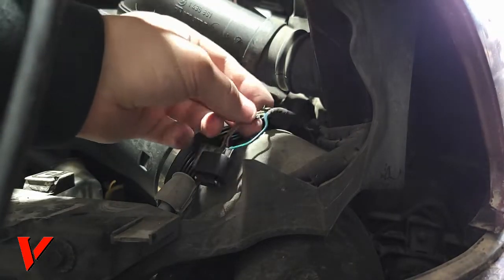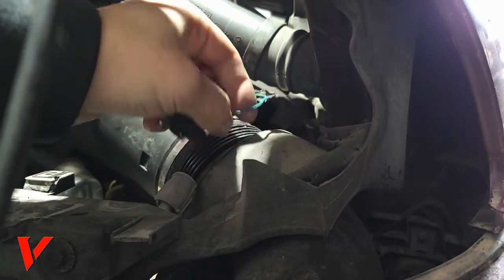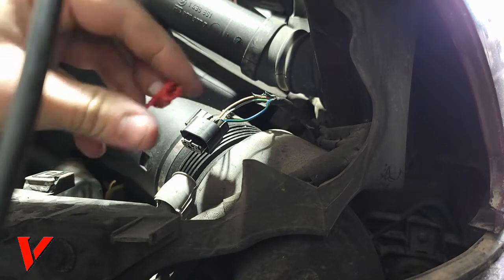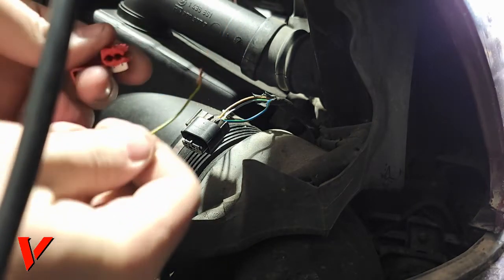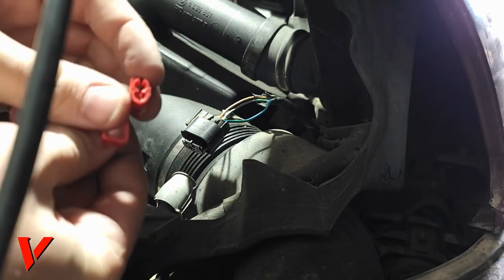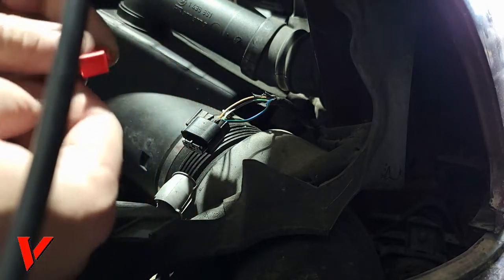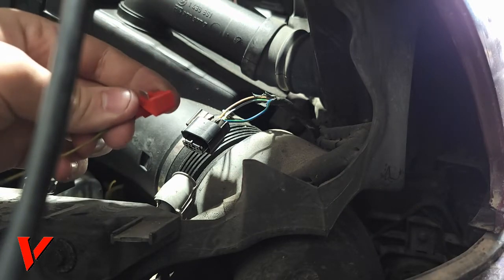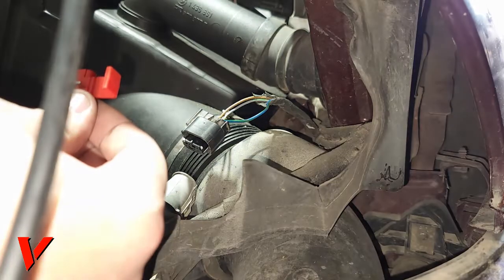Okay, so I took off some insulation here, some of the tape right there, to expose the wire a bit more. And what I'm going to do is tap into it with this. I gotta take my wire and put it in one of the ends, the one that has the dead end. You can see right here, one side goes all the way through and one doesn't. You want to put it right there. You want to have your pliers right by your side, and let me turn on the light, maybe you'll see better.